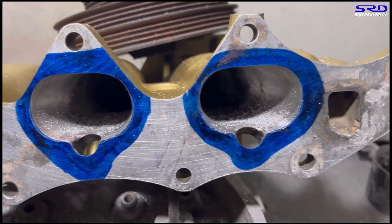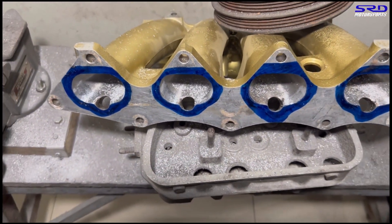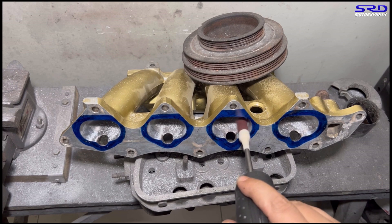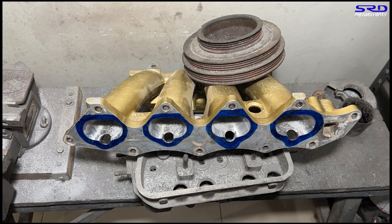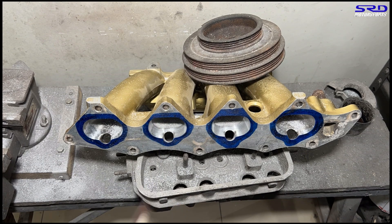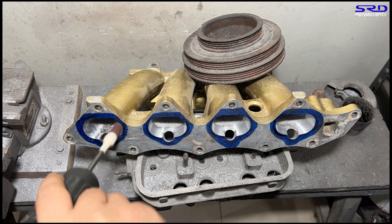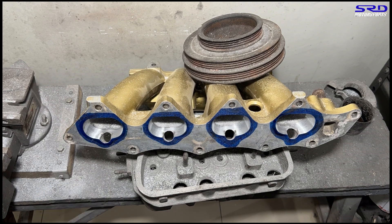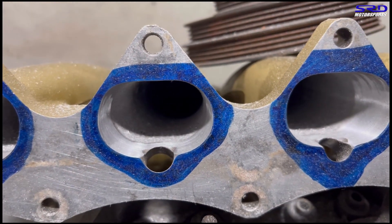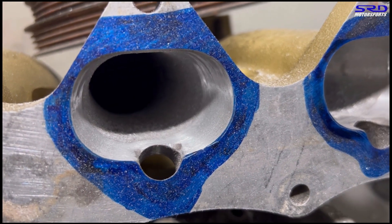You can see it's getting closer — now we're gonna go with 80 grit to get it really fine. With 80 grit we're gonna smooth it out, going deeper around six inches. Because this is already ported, if you go deeper than six inches it'll connect all the way to the other side. We'll show you the last half inch of the exit just to be quick. As you look closer, we're really close to that line we made, so it's perfectly port matched with a slight anti-reversion step — that's what Larry Widmer calls it.